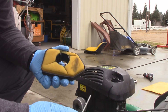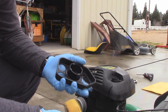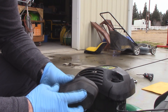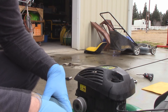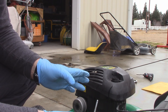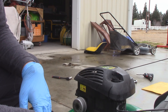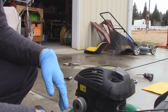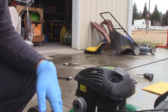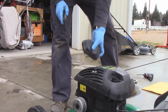I was going to service up the air filter, but it looks like that's already happened — probably due to the overfilling of oil. It's already pretty well saturated, and it looks like they just changed it. I'm assuming what happened is they tried to do a tune-up on their own, replaced everything they should have, but drained the oil and then, without even thinking, stuck a whole quart of oil in. Then we have this issue with the mower not wanting to run because it's hydro-locked. Very common, especially with people who don't understand. It's not a bad thing — it's just something you always want to watch out for. I'm not knocking this person at all; it's an easy mistake to make.